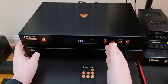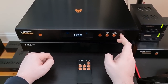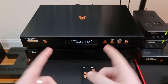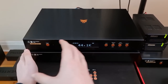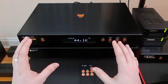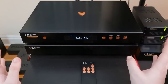Oversampling cycles through: OS, which is PCM to PCM and DSD to DSD; everything to PCM; everything to DSD; or non-oversampling NOS, which is how it's intended to be used. One thing to note is that with the PLL turned on there is some locking time whenever you first select a source or when there is a change in sample rate — sometimes two or three seconds, sometimes ten seconds depending on the song. There's not actually a delay in the audio, so you can still play games; it's just a delay before audio comes through. If that bothers you, you can turn the PLL off, though I'd recommend keeping it on for music use. If you use USB, there's no locking time at all, and the USB implementation in the May is stellar.